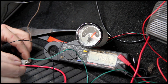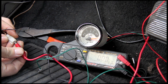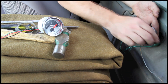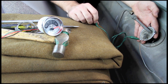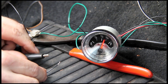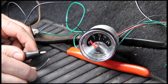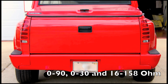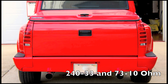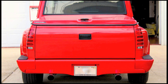Let's look at some common symptoms on fuel level gauges. A poor connection with the signal wire can cause the gauge to read higher than it should, or peg out completely. A bad ground for the sending unit can cause the exact same problem. A poor gauge ground can cause it to read lower than it should, or not come off the stop. This holds true for all gauges where higher resistance means a higher reading, such as GM and newer Fords. On gauges where a lower resistance level means a higher reading — like the universal aftermarket and the early Ford and Chrysler — the steps are reversed.